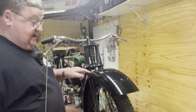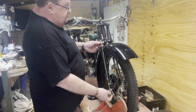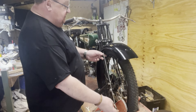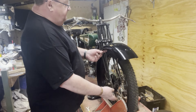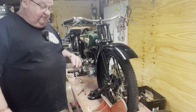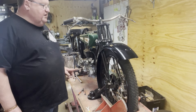I thought putting the drill bit down there would make a better result but it doesn't. Move to you so you can get a look - it needs to go into this piece and attach to the brake arm, but it needs to clear the mudguard stay. So I need to take something out of the edge of this hole and bring it this way. I'm going to put you down for a bit while I get my coffee and drink it and think about this, because this could go really wrong really quickly.